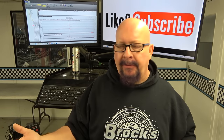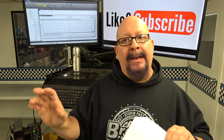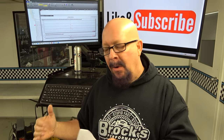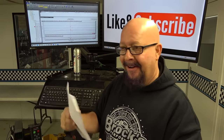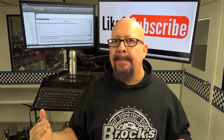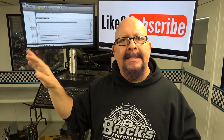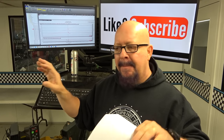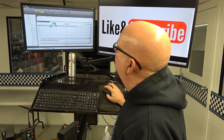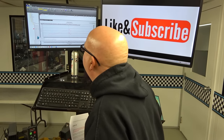Now, if you're a fan of the channel and you understand what we do around here, the number one horsepower gaining fuel for normally aspirated motorcycles that don't have a ton of compression is VP's MR12. The stuff's amazing. And this particular application, though, it was, God, I love my notes, 1 month later. So, unfortunately, that month happened to end up being in a warmer, more humid part of the year. So basically you sort of have to take out the old numbers and throw them away and start again. So we got the Gen 6 stacks, we put everything back, we got 89 pump gas, we've got our standard street map in there, basically the same configuration that we had previously, except now we're doing it in different weather conditions, and we have to get a little baseline run here.